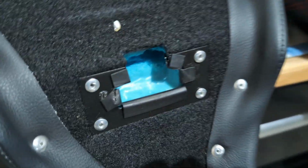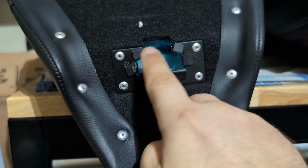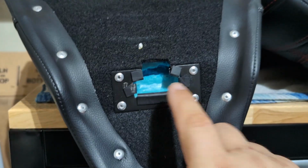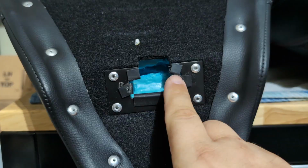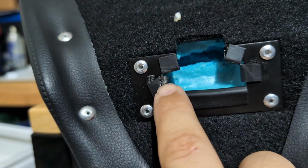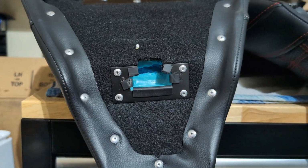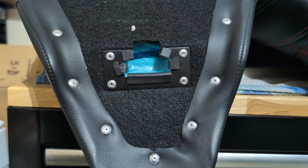The huge issue with Road Sofa is this. The hole is way too big, way too tall, way too wide for this mounting tab on the bike. So what people suggested is put these rubber U-channel things on there, and you can see after a couple hundred miles they look all messed up, they don't stay, and it's even getting destroyed by this piece of metal. And even then, the seat doesn't really stay rock solid and put at this mounting point by the tank, which really sucks. When you wiggle on your seat a little bit, the seat moves with you.